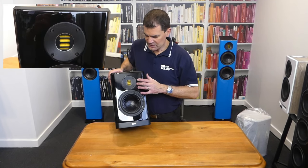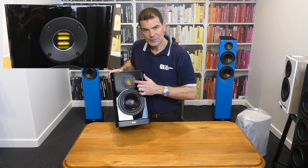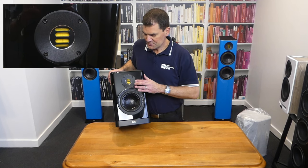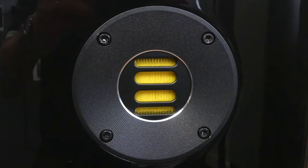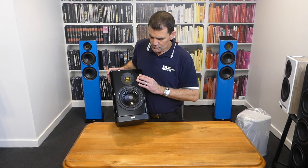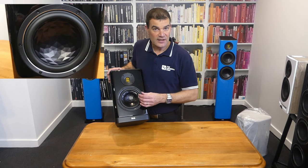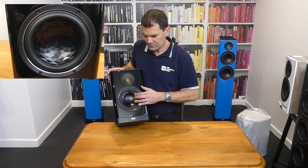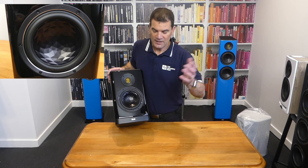They have the Jet 5 tweeter, and again, even the circular ring around it is designed to help disperse and manage the reflection of the high frequencies and bring them out to the listening environment. There are four exposed bolts, and again, it's well protected. You'd really have to have a go at this before you'd manage to damage the delicate ribbon behind. Then we see the 180mm mid-bass driver with the classic triangular texture that we've known to love in the Vela range. The annulus is soft but robust, and it's not going to suffer from any of the classic issues that foam surrounds had decades ago.